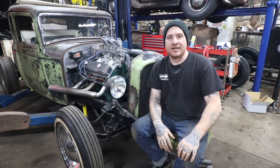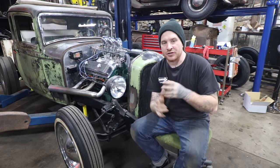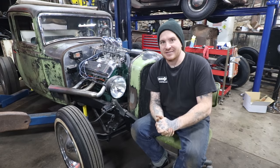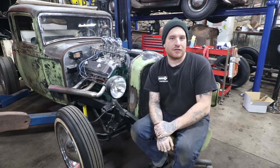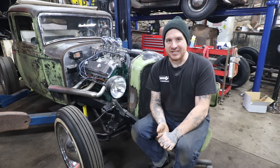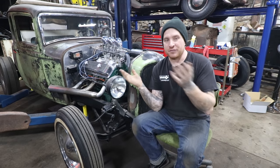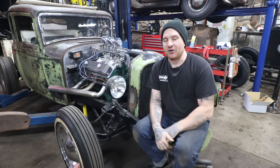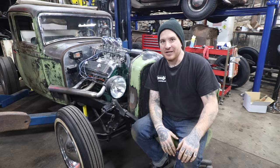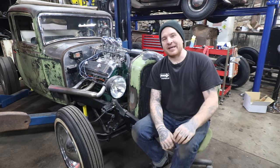The J2 engines, it was really just the intake and a bump in compression. And you can look at the cylinder heads to see what number they are. But basically it was just bolt-on upgrades to get that J2 engine set up — there are no crazy in-depth engine secrets in these things other than just normal stuff. I think it was a thinner head gasket they put on that bumped the compression up a little bit, and then those 3x2 carburetors. A lot of people that bought those cars with the 3x2s on them in factory form didn't even really use them because it didn't really come in until like three-quarters throttle, and a lot of people driving Oldsmobiles probably weren't doing that in factory form.